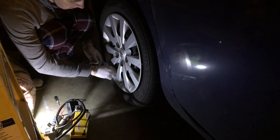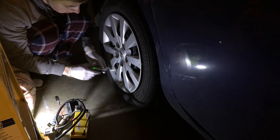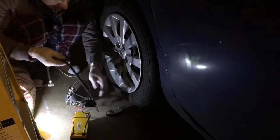That is a proper inflation range for high fuel economy — it minimizes deformation of the sidewall of the tire, maximizes grip, and you don't ever want to under- or over-inflate a tire.